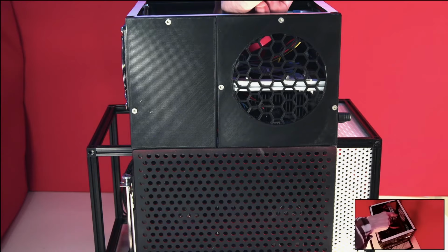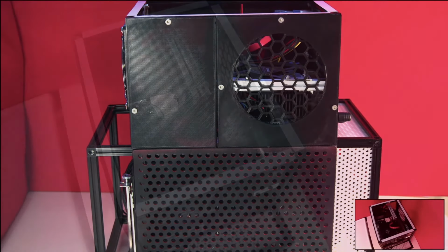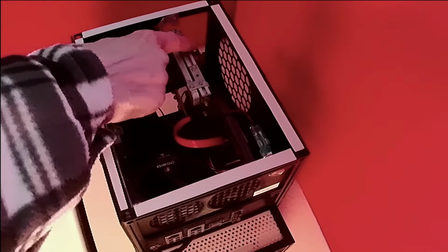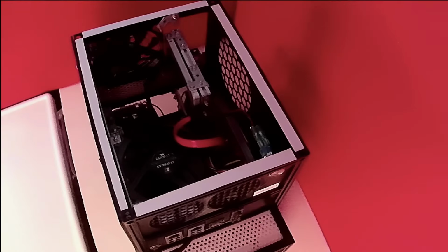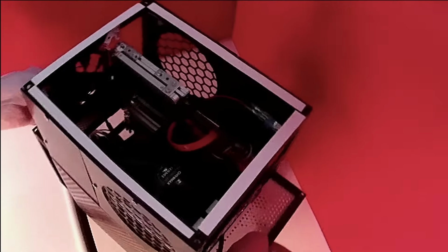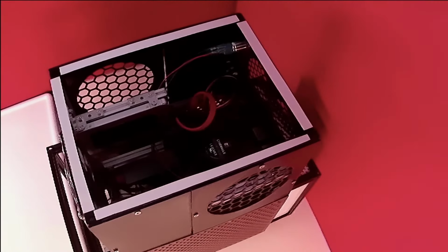When adding a new drive to a commercial case, you can usually just mount it in a free drive bay. As this is a custom case, while it does provide a lot of flexibility, it does mean that there is no ready-built drive bay to use. However, we do have an unoccupied area in the top of the case, beside the existing SSD, where we can mount the new volume.